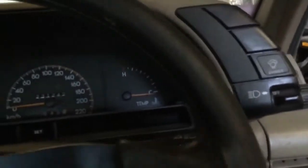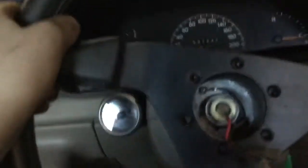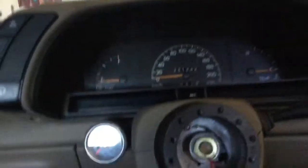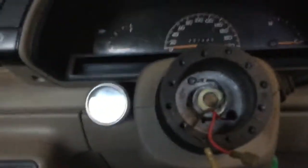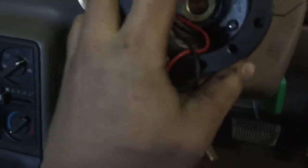You're going to want to get it so that it's aligned how your other one came off. Mine wasn't completely straight — it was on a bit of an angle. I might actually pull it back off and turn the boss kit back a little bit so it's more straight. You can do it however you want, just make sure your wheels are in line first before you start — that's the main thing. You don't want your wheels out of line because then your steering wheel is going to be out of line. I've put my hub on but the nut's not done up tight yet.